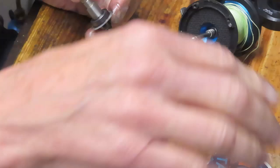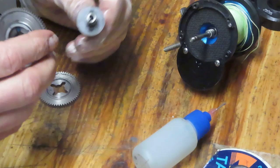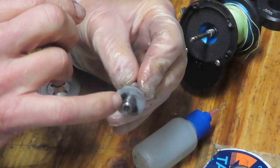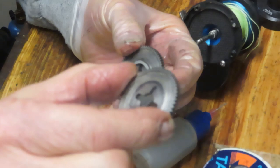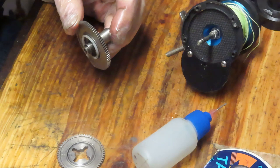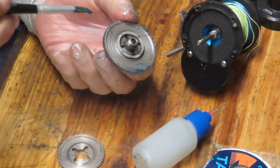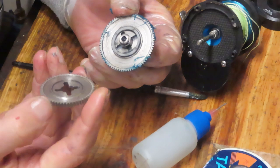If you have an issue with grease on the teeth, go ahead and get a hard bristle brush like a toothbrush or a regular dollar-store hard brush and pull that through. We're all clean on this — handle it and go back in the tray. Go ahead and pull off the main gear and clean the back of that. We have a bearing here — you can oil that. We heard a lot of squeaking going on, and I think that was probably from one of those. Remember how these parts were nested: this goes in next, and when you go to second gear this little cross pin is what pushes out and engages the second gear, so it nests inside the first one.